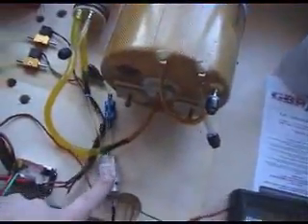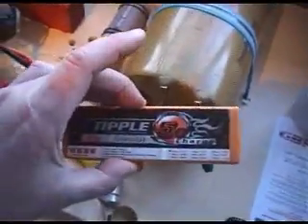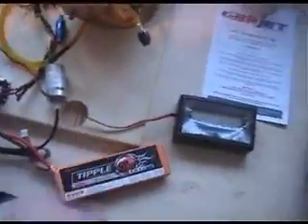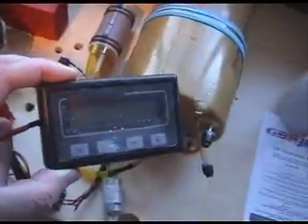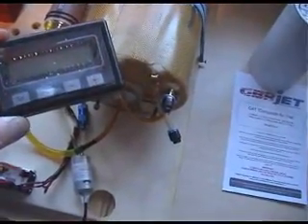The fuel pump and the brushless starter motor on the front of the turbine, which is used in the start-up sequence, are powered by a two-cell lipo battery — this is 3,000 milliamp. Kingtech recommend 4,000 milliamp, so I'll have to get something a little bigger for when I start flying. You can also run diagnostics on the turbine while it's running — either on the bench or in the model — and see RPM, temperature, and many other things on this data terminal. You can also configure the throttle curve and a number of other settings if needed.